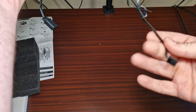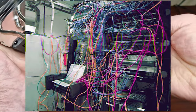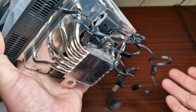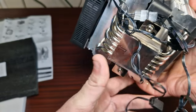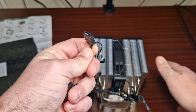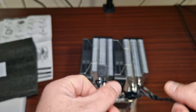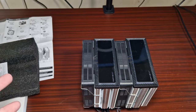There is an accumulation of wires though — it looks a bit messy. It is four-pin PWM which is a lot easier than three-pin, because with four-pin you can control it through your motherboard whereas three-pin runs off DC and can't. It's also three-pin ARGB so you can daisy chain it with the rest of your case fans.